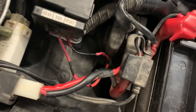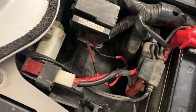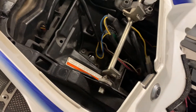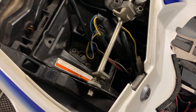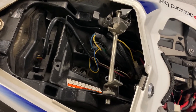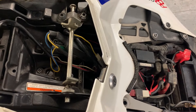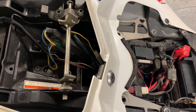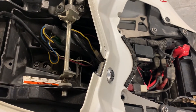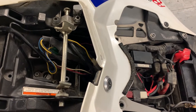I'm not exactly sure what had malfunctioned or why, but as I mentioned in one of the earlier videos, sometimes the taillights would just come on when you wiggle the wires back in where the T-tap connector was. That orange connector, connected to the taillight, is supposed to receive switched power when the bike is running — but it was getting power when the bike was off. What was happening was that the orange wire from the alarm had a continual 2.75 volts going through it. There was a bad connection with the T-tap to the taillight wire, which is why the light wasn't on all the time, but when it made contact it was feeding power to the taillight continuously.